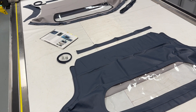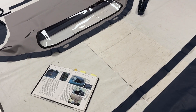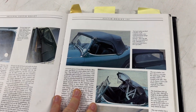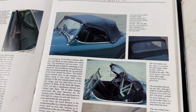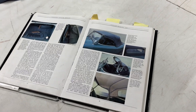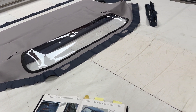This is a very common theme with weather equipment, especially soft top hoods — anyone that knows anything about these parts will agree that hoods are a very unique and bespoke area of the car. All sorts of factors can play a role in how well they fit: mainly the condition and fitment of the hood frame metalwork itself, which can often be bent, warped, or crooked. Then you've got the doors, how crooked and bent they may be, the same with the pillars for the windscreen, and any number of other factors — not to mention the manufacture of the hood itself.